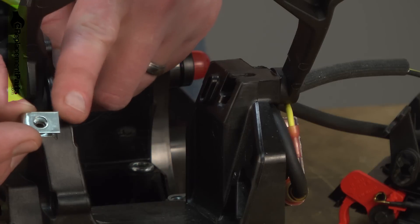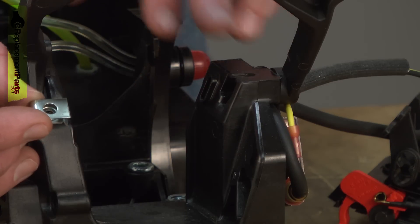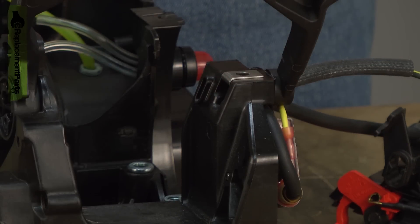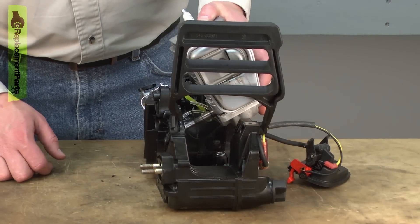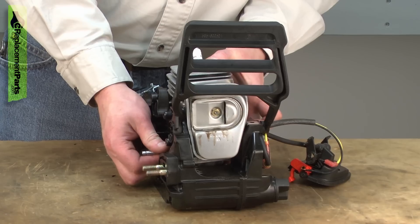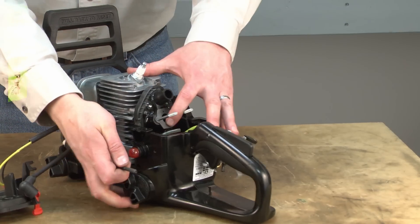This is one of the clips that secure the top cover. If this clip on the front of the saw has fallen out, you'll want to make sure you reinstall it now because you won't have another chance. Now place the engine back into the frame — just be careful that the crank case doesn't come free from the cylinder as you do this. Now it's in place, I can re-secure it with the bolts.